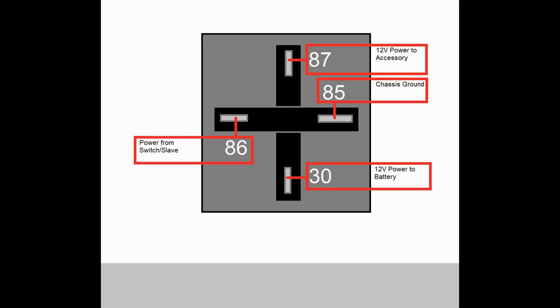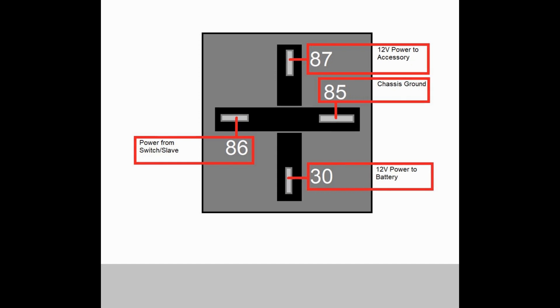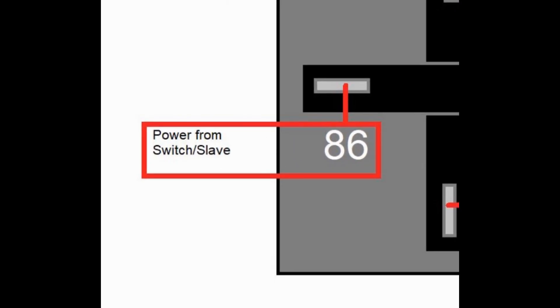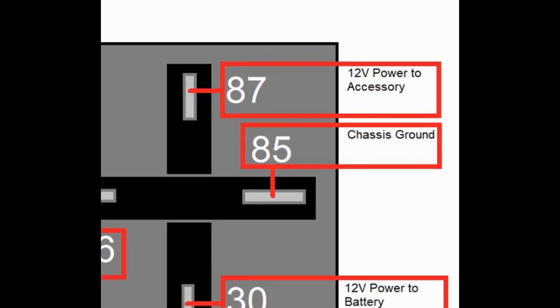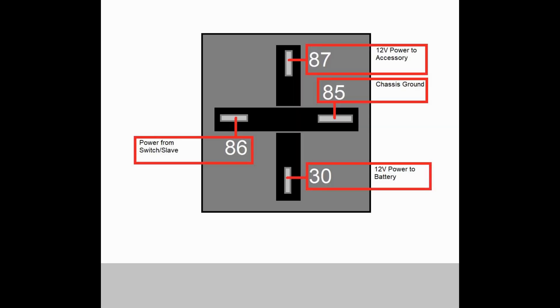I wanted this video to be a one-stop resource for this entire project, so I'm including a diagram of the relay terminals and how to wire it up. 12-volt relays like this are virtually all standardized across the industry, so no matter which manufacturer you get yours from, it's likely to have the same terminals numbered the same way. If you need to make notes, take a picture or get a screenshot and pause the video now. Terminal 86 connects to the power wire or positive wire of whatever circuit you're using to trigger the relay. In most cases, this should be either the license plate lamp or an accessory circuit the manufacturer has built into the bike. Terminal 85 is just a ground wire connected to any good ground. If you're not sure where to ground to, use the ground bus on the fuse block — that'll work fine.